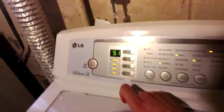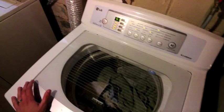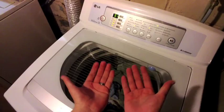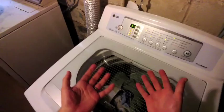You'll notice the first step in the washing cycle is load sensing. If you were designing a washing machine, how would you measure what's inside there so that you know how much water to add? One of the first things you might do is just weigh how much stuff is inside the machine. But I don't think that'll work — what if you just put in one or two things that are really heavy, like two or three wet towels? Those towels would weigh a lot, but they wouldn't need much water to cover them up.